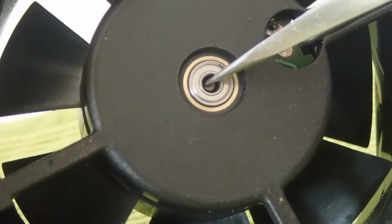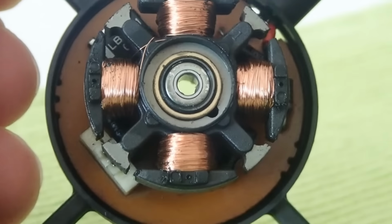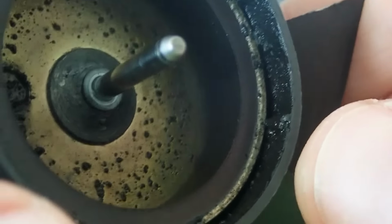Inside, the fan was sitting on a spindle which was held by two ball bearings. I guess this is not always the case. Some cheaper and especially smaller fans wouldn't have any ball bearings at all, I guess, or have just some steel balls directly located in the spindle tube. So be careful removing the spindle or you'll spend the rest of the week searching for tiny steel balls all over your place.